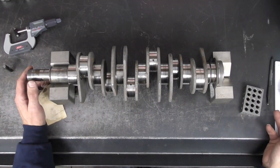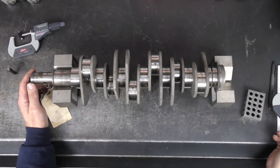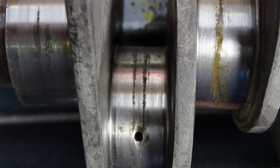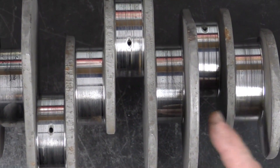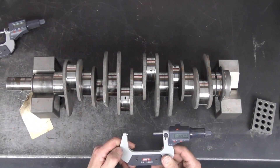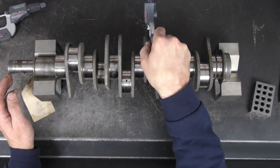So on the first crankshaft we looked at, it was in pretty good condition as it came out of the engine and measured at a standard dimension. We have another crank out of another engine — I've just washed it — and the first things I see are very heavy scoring. This is what you are looking for: heavy marking like this. If I bring my fingernail over it, I can actually get it trapped in all of the little scoring marks. The next problem is when I have my micrometer set at the low end of the standard dimension, it slides over the journals easily — it slides over all journals, both rods and mains, easily.